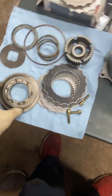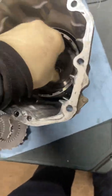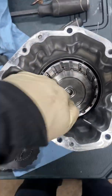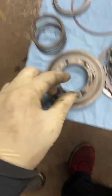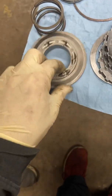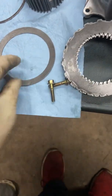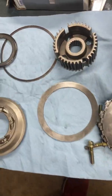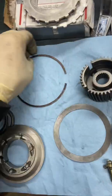Basically what you're going to need — make sure that this didn't fall out. This normally doesn't come out, but it sits right here on the bottom. When you take this all apart, you're going to have the spring, the ramp cover where the balls would go, all the steel plates, this concave/convex washer, this bearing, the hub, and the snap ring.